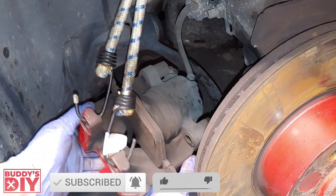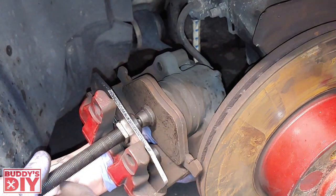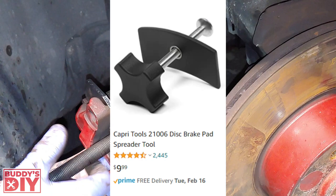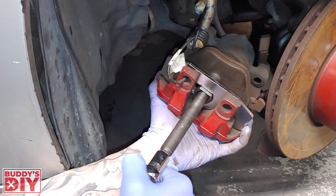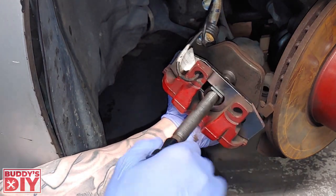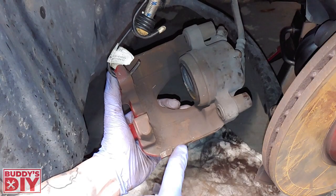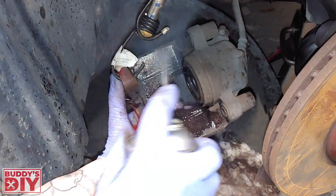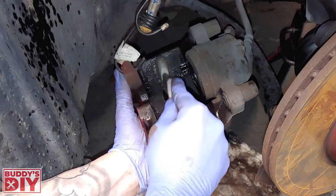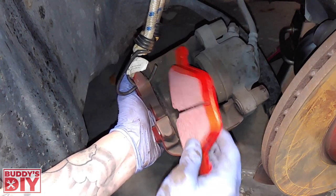Now that we're done cleaning the bracket, we'll start on the brake caliper. We'll take the bungee cord off and fit our brake piston compression tool into the caliper, getting it hand tight. There are many variations of this tool, but I'll link the cheapest highest-rated one on Amazon in the description. Using a socket wrench, compress it down until it bottoms out and you can't crank it anymore, then loosen it just enough to remove the tool. At that point we can pull out the old brake pad. Before installing new pads, spray the caliper interior with brake parts cleaner and give it a quick scrub, then spray away the loose gunk — we want it free of gunk and grime since the new pads will be sliding in there.